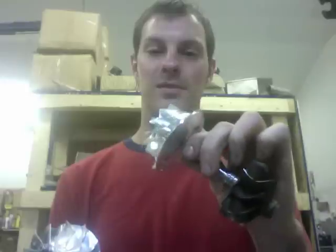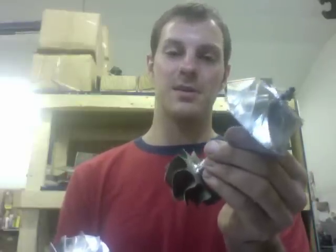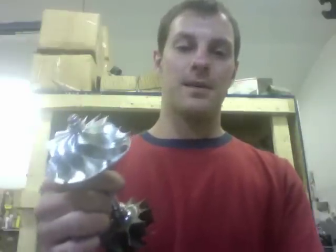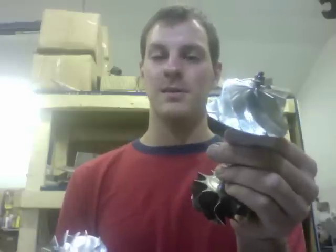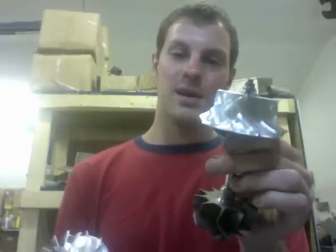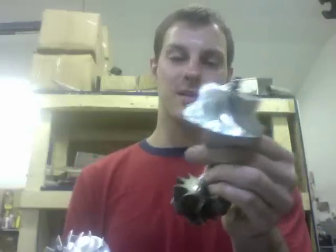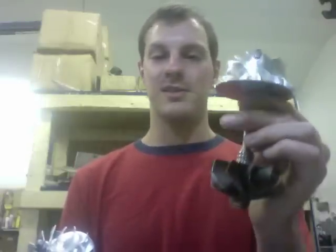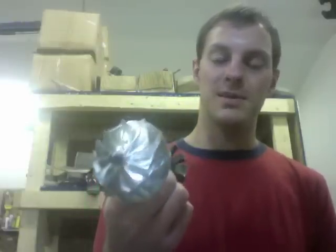Garrett rates the 3071 for 580 horsepower — you could probably make close to that with the 1.06 turbine housing, but realistically most people aren't going to run that size turbine housing with the GTX 3071. In my opinion, this 3071 is good for a four-cylinder engine at most 2.2 liters — probably nothing bigger than that. I'd probably put this on a 2.0 or smaller engine.